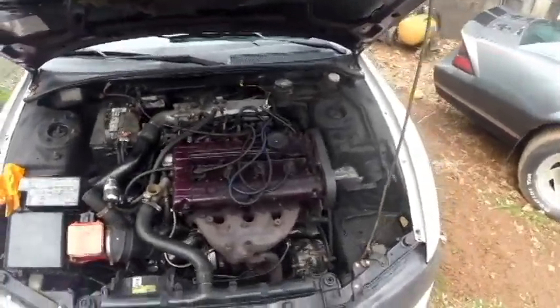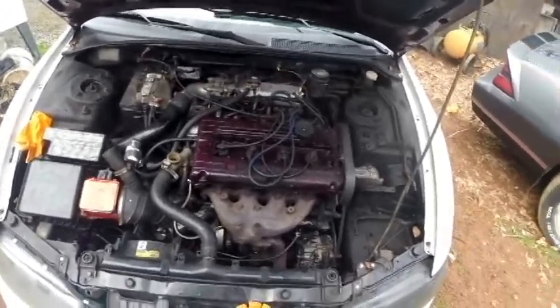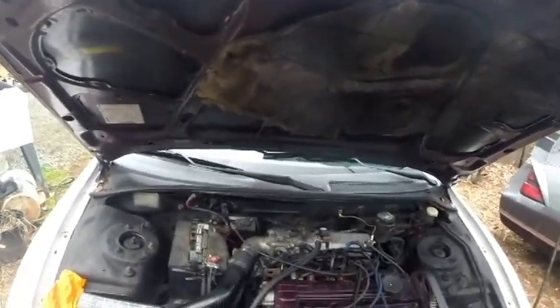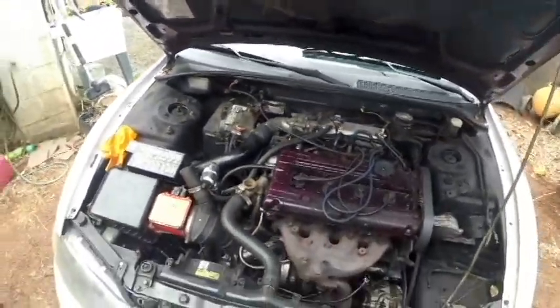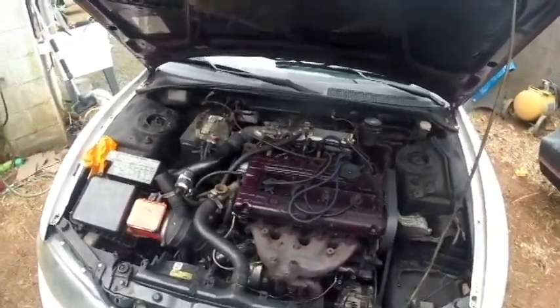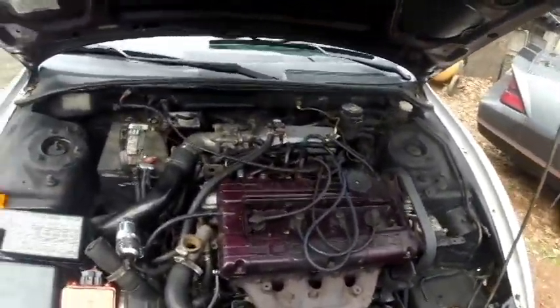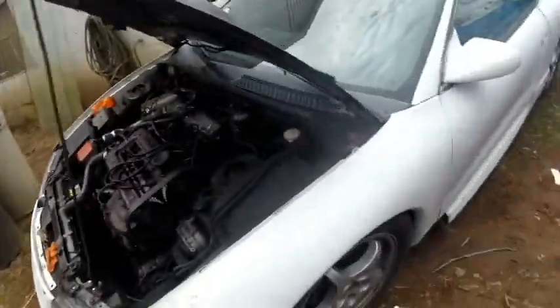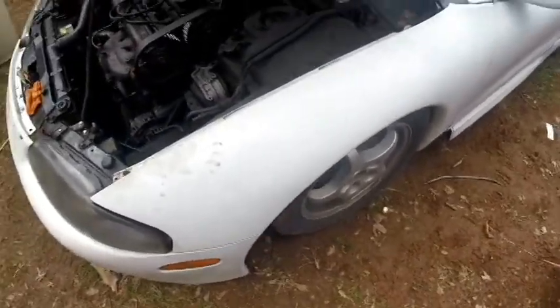I took it off and went through the turbo and found out that the reason it went out was because the heat shield on the inside of the turbo had broke loose and it was catching the turbine and not allowing it to spin. So I pulled that apart and rebuilt it, just because I'd rather rebuild it than just replace the heat shield. No play in it. The turbo works now, but it's idling really high.